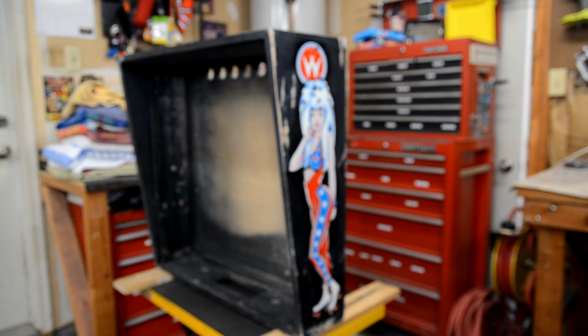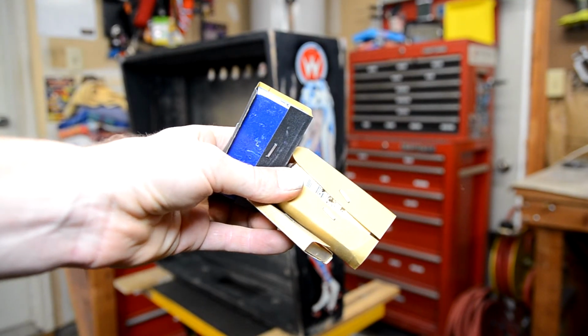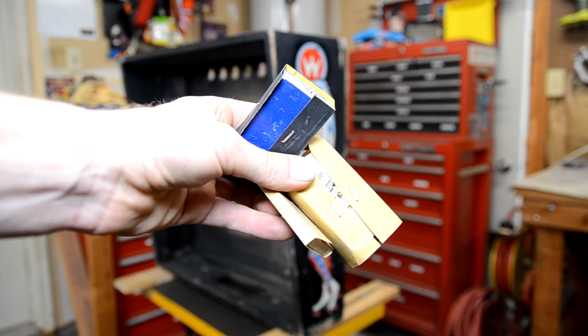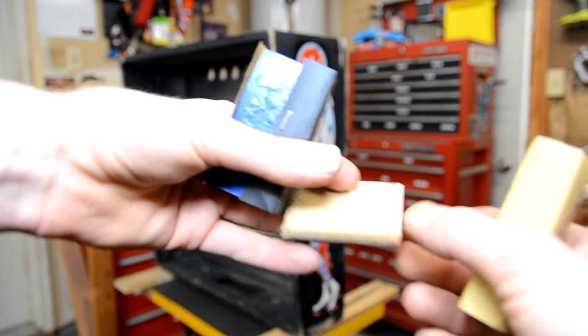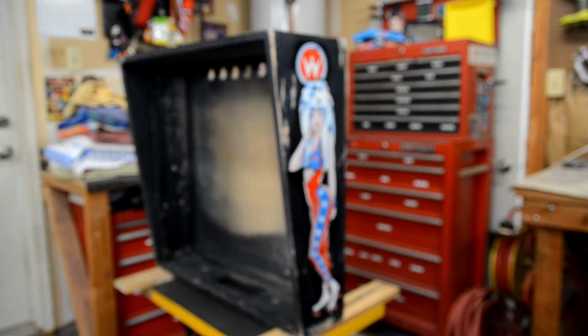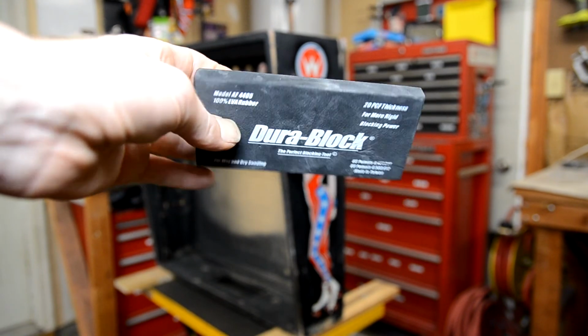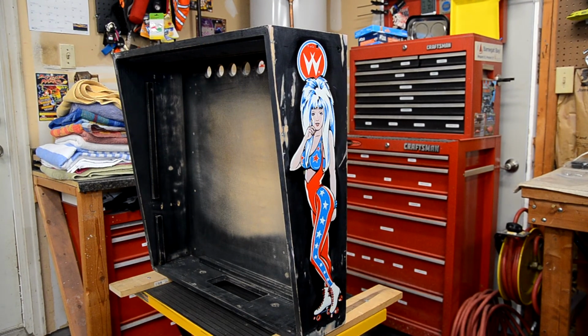And then I have a bunch of these various pieces of wood. They're just little scraps of wood. I wrapped the sandpaper around them, and I put a couple staples in them. So I have 150 here, which is just to roughly shape the Bondo the way I want it. And then I went to 220, and then 320, and then 400. And then after the 400, I used my Dura Block here and wrapped this with 600 grit. Then I went over the whole cabinet with 600 to smooth out all the sanding scratches and really smooth out the Bondo. So the cabinet is pretty much ready for paint, and we will be doing paint in the next video.